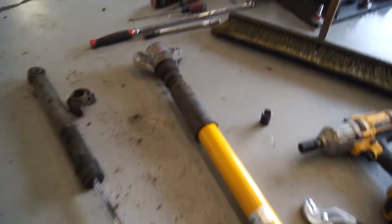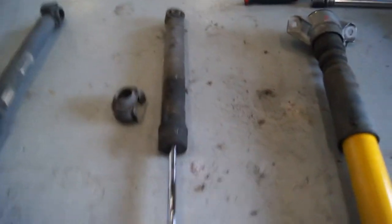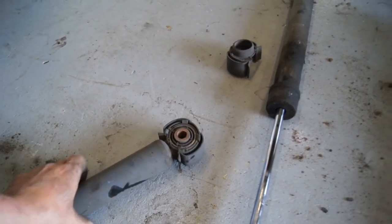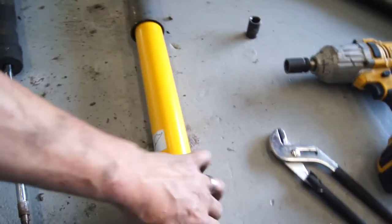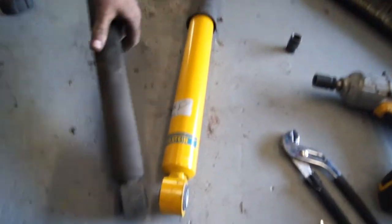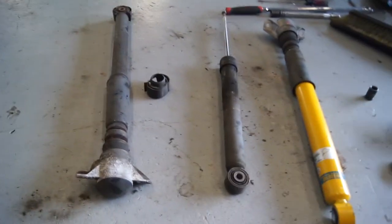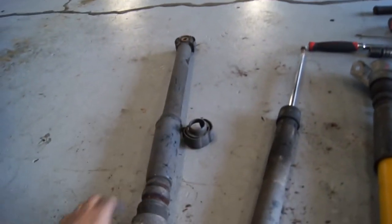Got that one on. Like before, the top nut comes with a new one — it's one size bigger. The stock is 16 and the Bilstein is 17. I noticed this goes on the bottom here — it's just a snap-on plastic thing, maybe a rock guard. But the outer diameter of this is too big, so I'm going to have to leave those off. You can see it's a little bit bigger. At any rate, I've got one more to do and then we'll throw them up in there. This thing just pops off, captures on the nut, and then spins off.